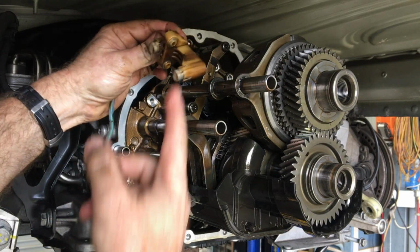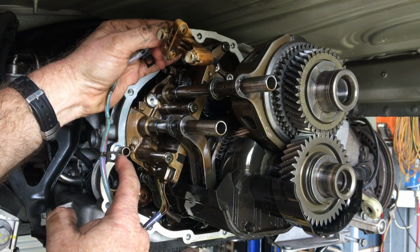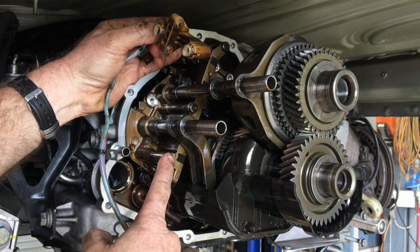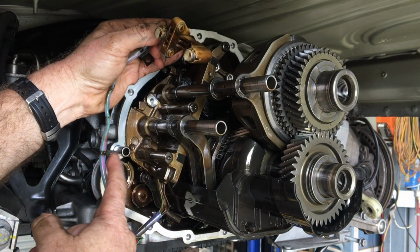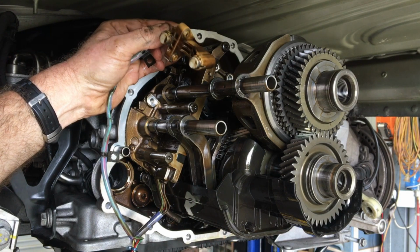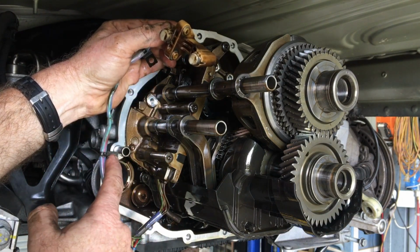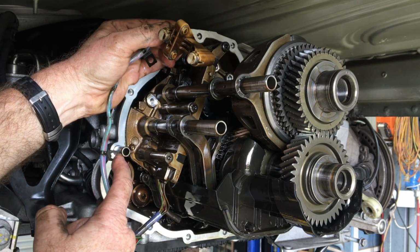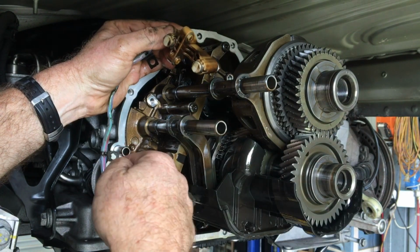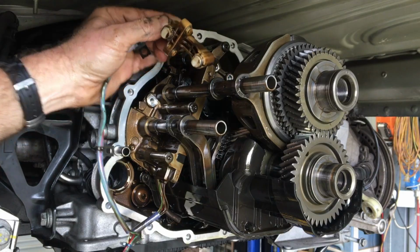When you're removing the screws on the sensors, and especially these ones here on those clips, these are T30, the sensors are T27. I would use a long extension that runs out the front and a breaker bar, so it's quite a long bar so you can really control it, because especially these ones here, even though they're only M6, they took quite a bit of force to get off, and if you didn't have a whole bunch of control to keep the thing forced in there and perfectly at 90 degrees, it would be easy to burr those off, so just be a bit careful there.